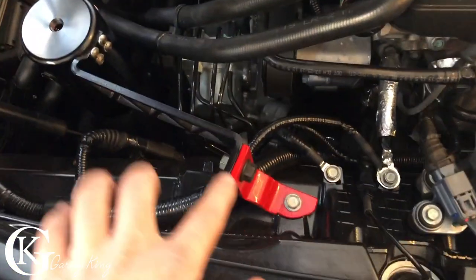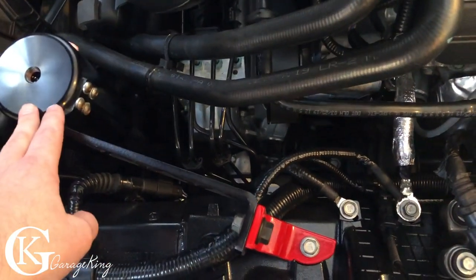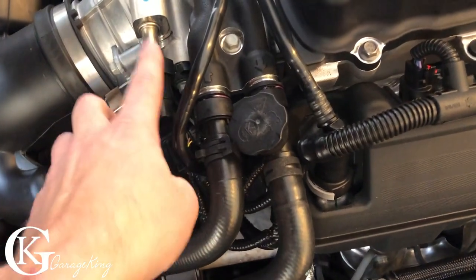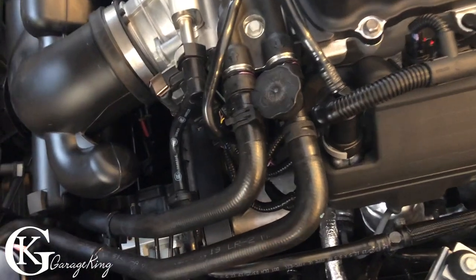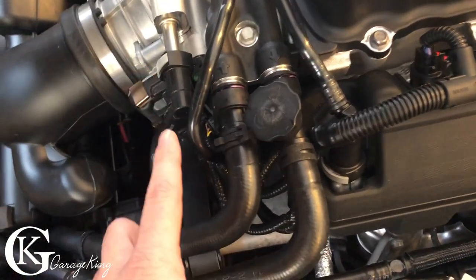So now we have a soft installation of our catch can, just basically how it's mounted. Now we're going to want to have vacuum all the time because you definitely don't want to have crankcase pressure. So what we're going to do is basically what everyone is doing these days. We're just going to use a vacuum from behind the throttle body here. So we'll get vacuum from there, but there are times that there is no vacuum there